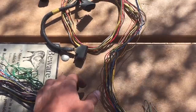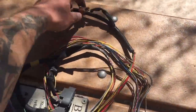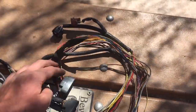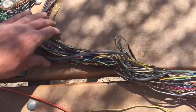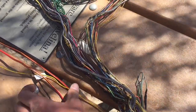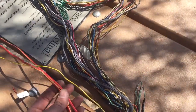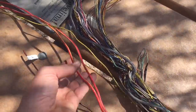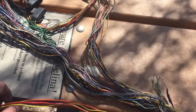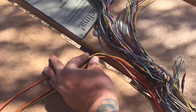For the engine bay, we also have the pressure sensors, the igniter, and the mass air flow — those are going to be in one string. Branching off that string we'll have the ignition on, the fuel pump, and the starter wire that needs to be trimmed down — there's a junction there we're going to clip. The vehicle speed sensor is also going to sit on this side spur.